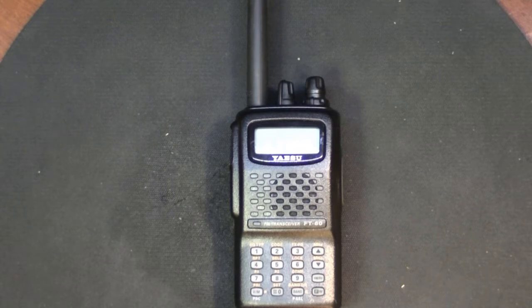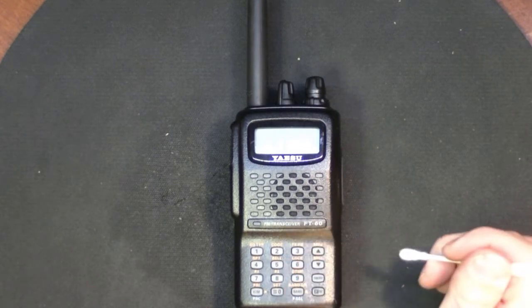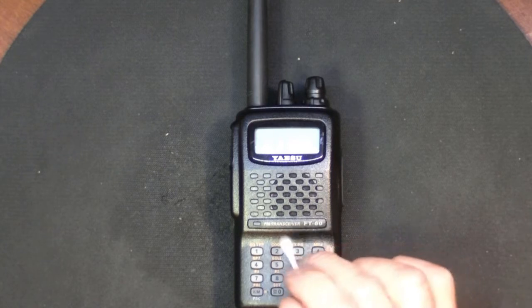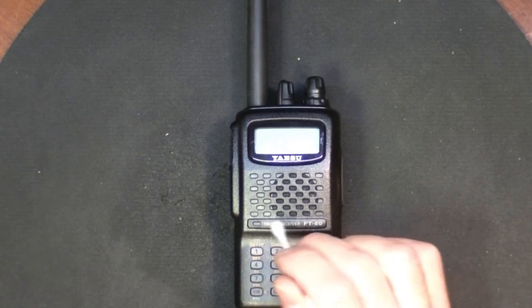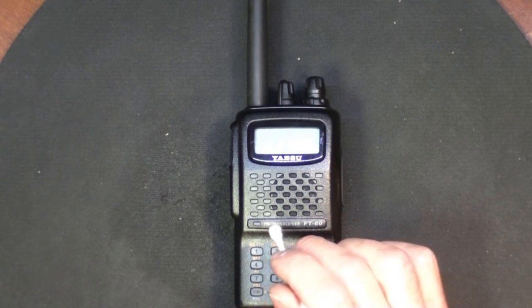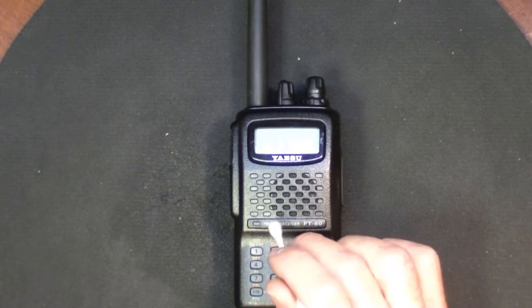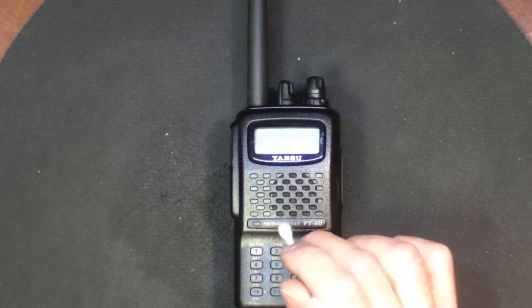In my opinion, these radios are a little bit on the quiet side out of the box and they need a little help in the audio department. I know one thing that would help the audio on these — if you take the case and open it, on the other side of the mic hole is a membrane that can be removed because it's blocking the audio between the porthole and the mic, and that will help the audio.